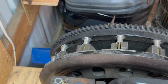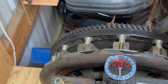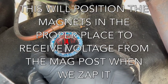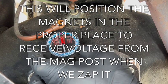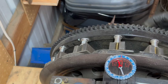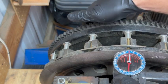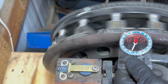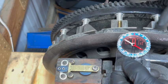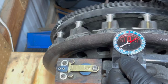So here's basically what we're doing in the car. We're putting the compass near the mark that we made, and then we're rotating the engine until north lines up with two of the north poles of the magnets. You can see when you spin it, it's going from south to north, south, north. If you rotate it too quickly, it does not give you a good reading, as you can see. So now I've got north lined up with the magnets just like we've got it in the car. The magnets and the field coils are not visible when you're doing this in the car — this is just an example of what's actually taking place and how it looks and why the needle is doing what it's doing.